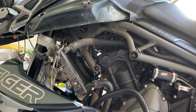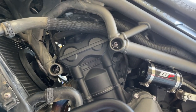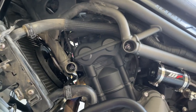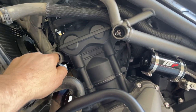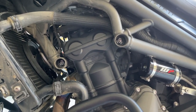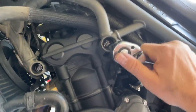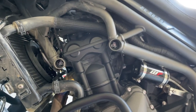Time to get working on the left side. First step on the left side is to remove the front and rear frame to cylinder head fixings right here. Keep those, reuse any spacers if there are any, and discard any lock nuts — you've got to replace them with new lock nuts. Let's give this a shot. I think it's going to be a T50 still — yep, T50. No change on the Torx bit.